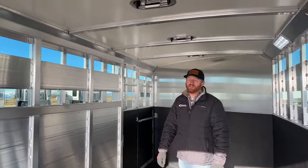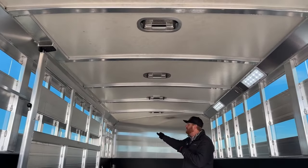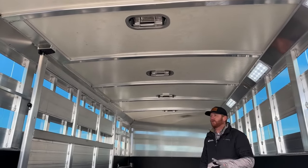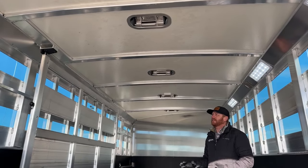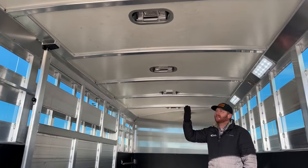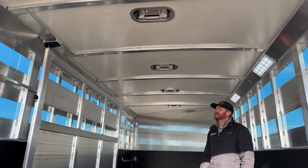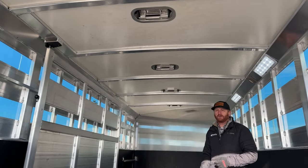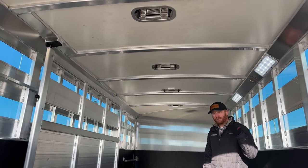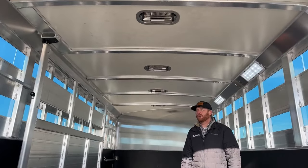We cap it off with an insulated roof — that is standard on every single Cimarron. We have two-way roof vents, about four of them — two up front and two behind the gate. That roof versus an aluminum sheeted roof keeps the stall area about 20% cooler in really hot summer months. It's also strong — it can take 150 pounds per square foot and substantial hail. We had a hailstorm here on May 9th that dinged every single aluminum-sheeted roof trailer we had, while the Cimarrons made it through with no problem.